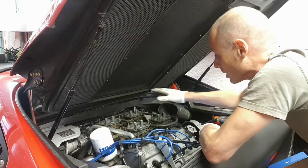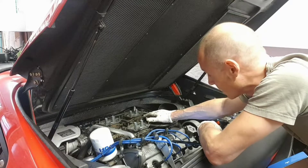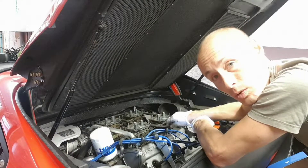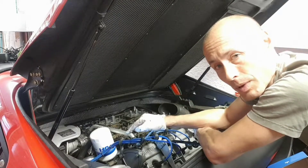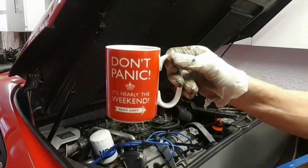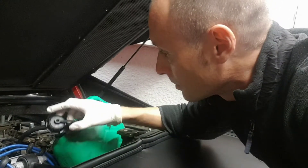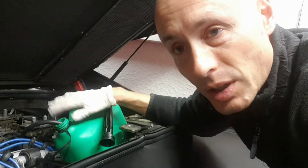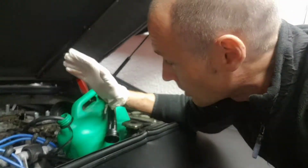The airbox is off now, got access to all the carburettors. I'm not going to do much with those at the moment — first job is to check there's fuel coming around, have a quick look at these fuel lines, and empty the tanks to replace that pipe down the bottom. I've now got most of the fuel out of the car — literally took one of the pipes off the feed for the carbs, straight into a jerry can, ignition on, let the pump do its job.